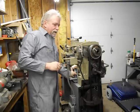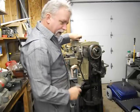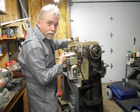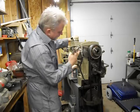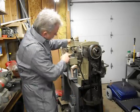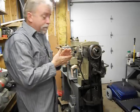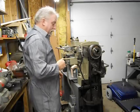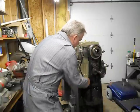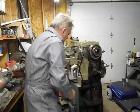Let's go through the mechanism I found for actually bleeding these. One of the things I noticed — I know I'm turning this with the lathe off, the motor off, but we're going to correct that in a moment. When you come back, you can hear that this system is actually open — from anywhere on the high pressure side through to atmosphere. At the low end, where our speed is low, if we lock this back just with a simple vice grip pliers, the system is actually open. I've gone through the factory-recommended bleeding procedure, and what I found is that's not a very good method — it's not real conducive to getting the system bled out.